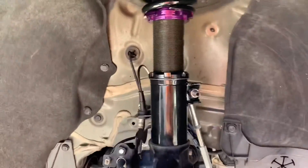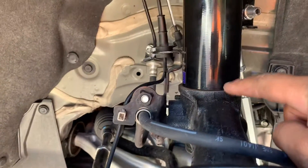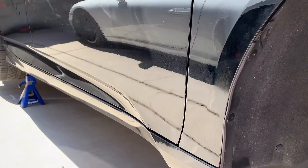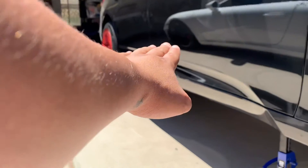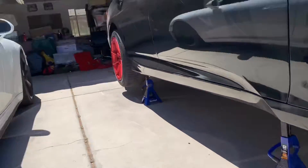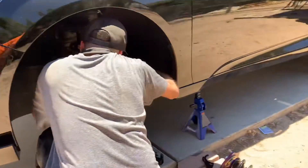You guys can see he has his car sitting real pretty. He's helping me out right now because last night, with these coilovers that have the adjustable sway bar end links, I had them flipped the wrong way around and this part wasn't fitting flush. On top of that — if you follow my Instagram or Snapchat — the car was sitting crooked. When he came over we looked underneath and the rear jack wasn't even touching the bottom of the car. He helped me adjust all that.